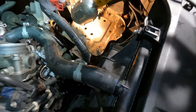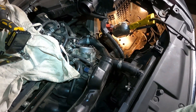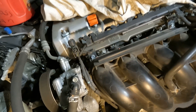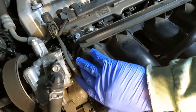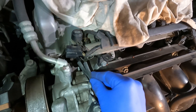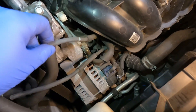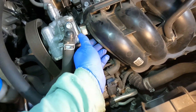Finally got this out. There's coolant everywhere — I went ahead and loosened the upper radiator hose to be able to get this air intake contraption out of the way. I was able to lift it up and finagle it all the way out. Coming over to the left side, these two vacuum lines — pull these off to give room for the intake to come off. You've got one here and one here — one goes into the intake manifold, the other goes down lower.